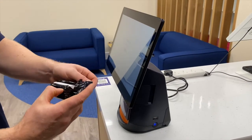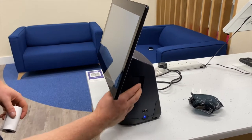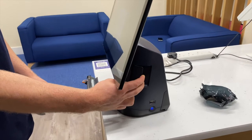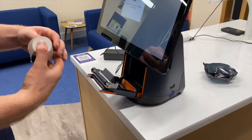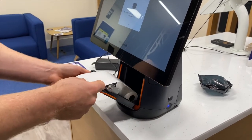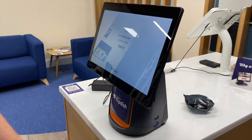Now let's look at how to add printing paper to the T2 kiosk. Step 1: Release the clip on the side of the kiosk — the front end of the kiosk will fall down. Place the roll of paper into the kiosk, then close the door and the printer will automatically cut the paper. Remove the waste paper and you're good to go.